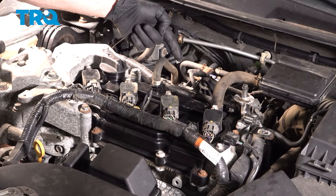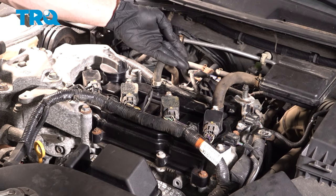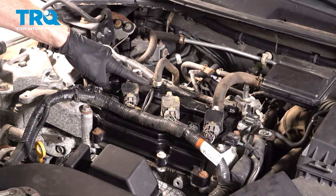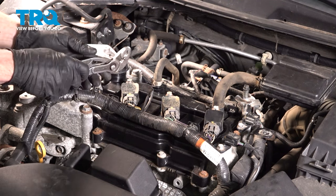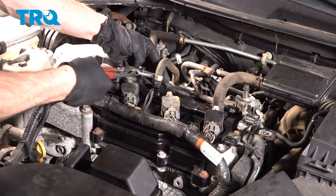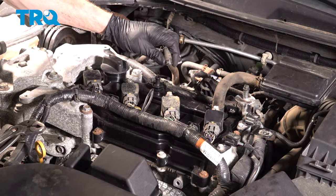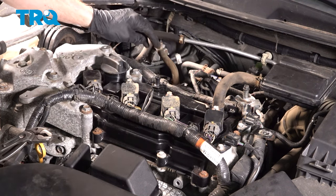Looking along the backside of the engine, you do have a clear view of the fuel rail which houses the fuel injectors, but we have to do a little bit more digging so we can start removing it. Let's start by removing this hose from the top of the valve cover — you'll find that it has a clamp. Squeeze that in, slide it up, remove the hose from the valve cover. Give it a quick inspection, make sure it's soft and pliable. You can twist this off to the side and out of the way.